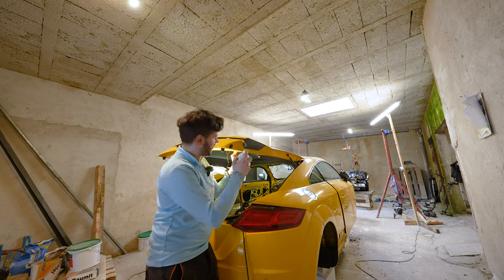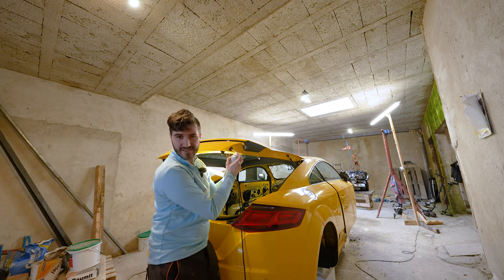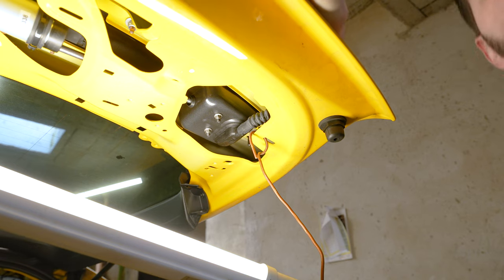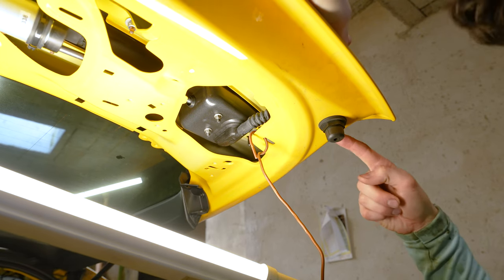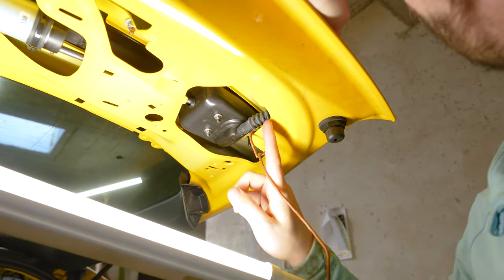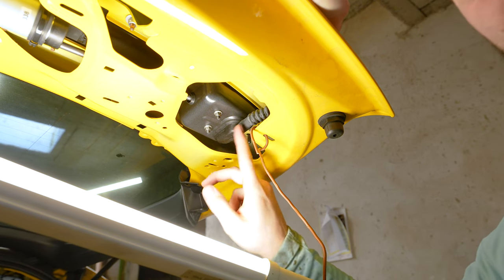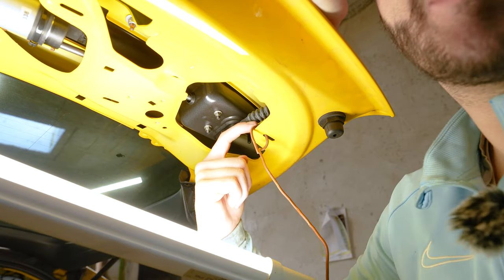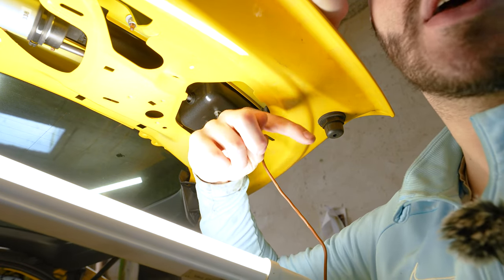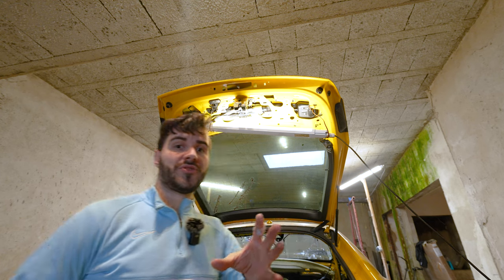The other thing you can do if you bought a can of compressed air is shove the tube inside the drain and give it a nice boost. I'm really doing my best to give you the best angles possible. This is the lower hole on the side of the boot lid — you can see very clearly this is the drain pipe that goes from the base of the spoiler through here and out on this side.